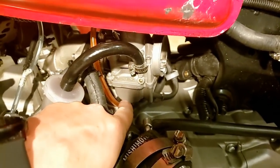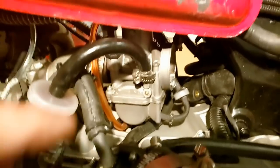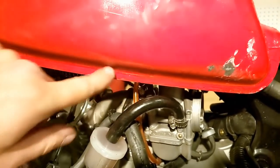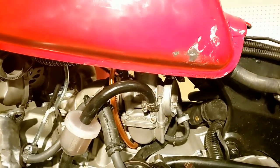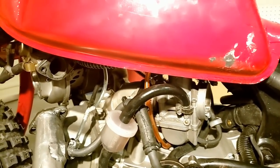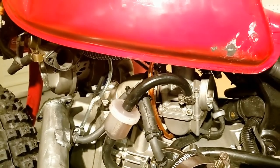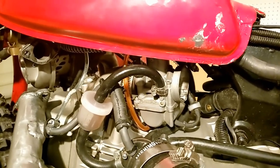On the other side there's a fuel screw you'd loosen to drain the fuel bowl — I take that out and actually epoxy it in just to help with sealing. Some carburetors have a top where you can unscrew and take the slide out — you want to tap that part and put a nipple in it, referenced to boost as well, because sometimes the spring in there is not enough to overcome the boost pushing the slide up and the motor can run away. It's more of a two-stroke thing but it can happen on four-strokes too.